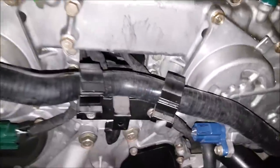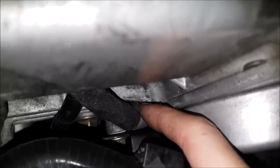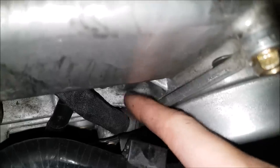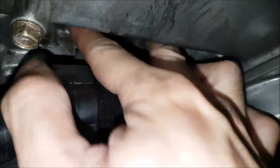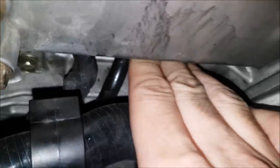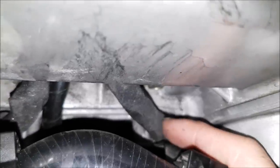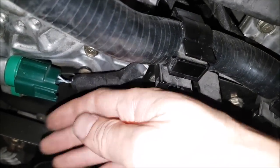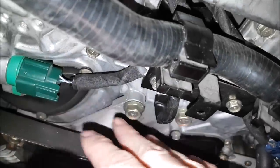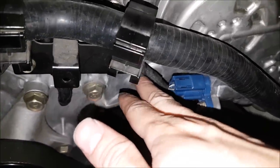Version two is done. This is what you typically see people do. As I said, ran it down this way, came out here. I used smaller clamps because I had to have a clamp fit right in here, and I like to use the stainless ones that have an insulator on them so it keeps it off the engine — it's not touching the aluminum, it's actually just floating in there. You can see my ground wire. We can zip tie these three together and they'll kind of hold each other in place. I don't think it's that hot in here, but if I can manage them in a way that they don't touch anything, all the better. I had to readjust this twice. You want to be able to move it a bit — you don't want the wires pulling on the plugs. I never like having wires pull on plugs, so we had to make sure we had a little bit of slack.